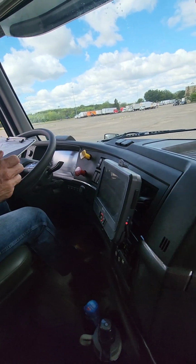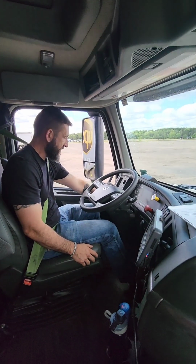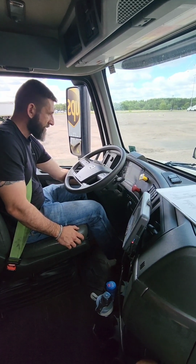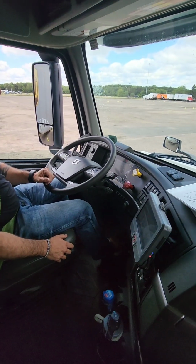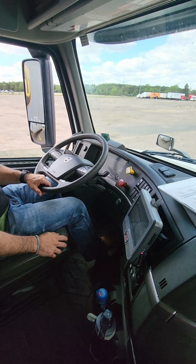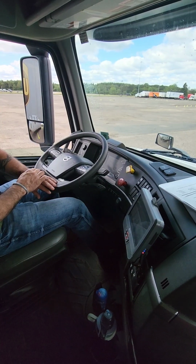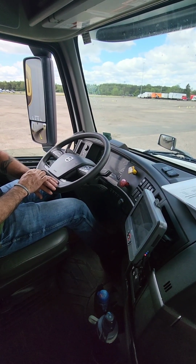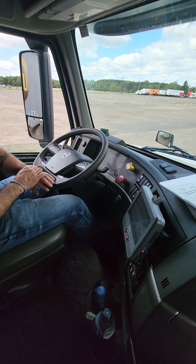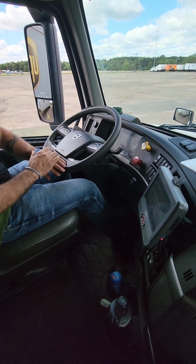Next, we have our air brake check. Our air brake check, we are going to turn the vehicle off first. Then we're going to flip it back into the run position. All right, our gauges all work properly. We're going to check our service air brake leakage test first. So we're going to release our trailer brake and our service brake valves. We're going to press our service brake in, and we're going to wait 1 minute. And we should have no more than 4 psi loss in that 1 minute. All right, our 1 minute's come and gone.